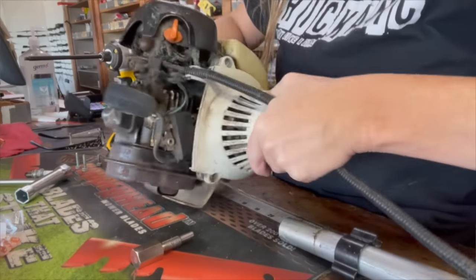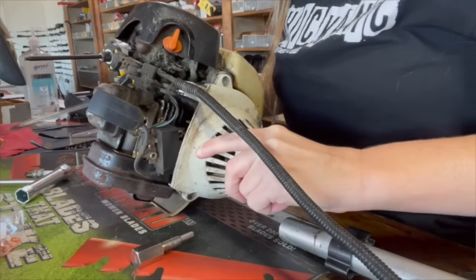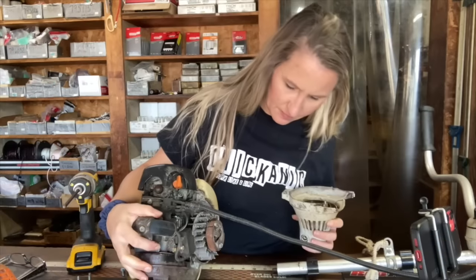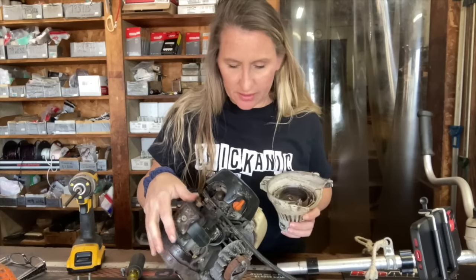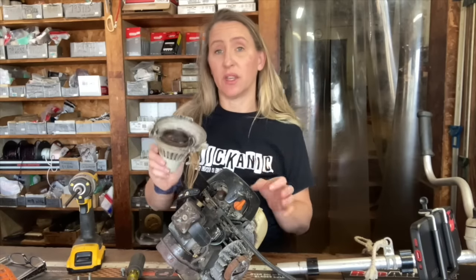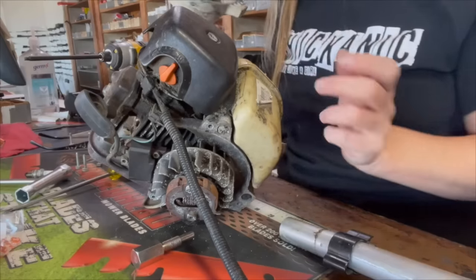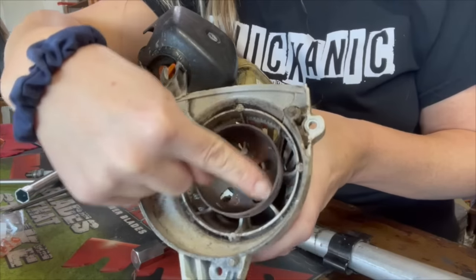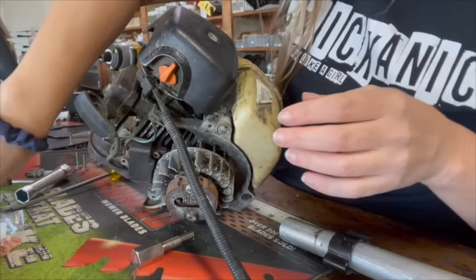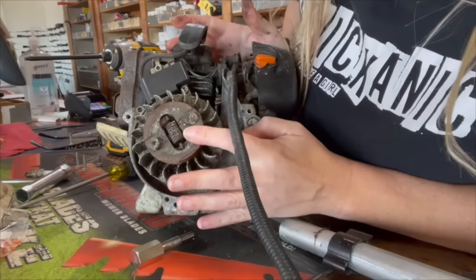That's the clutch making a releasing sound. So there are two issues I see with these clutches most of the time: either they've exploded and stay constantly engaged, or they've rusted closed and will not engage. This one must have sat for a long period of time — it's got tons of rust in this bell housing. We're going to clean all that out and it should be fine. But this thing is just rusted so bad, we're going to go ahead and take that off.